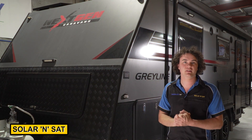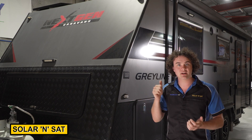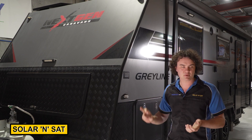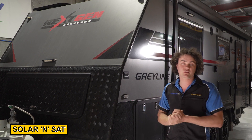We've got this next-gen caravan and we're doing something a little bit different. We're actually going to be removing the factory battery management system, which will require us to replace the pump switch, put a fuse block in for the existing loads, as well as replace the water tank sensors. What this lets us do is run a whole Victron system top to bottom — we're not going to be running through any factory gear. This increases reliability for the customer because you're not relying on two separate battery management systems to both do their job at the same time. We've deleted the factory one and we're just relying on that Victron touch screen to tell you your water tank levels, your battery capacity — everything all at one point. So it makes for a much more finished installation, a nicer look, and increases reliability because you're running purely through that Victron gear.